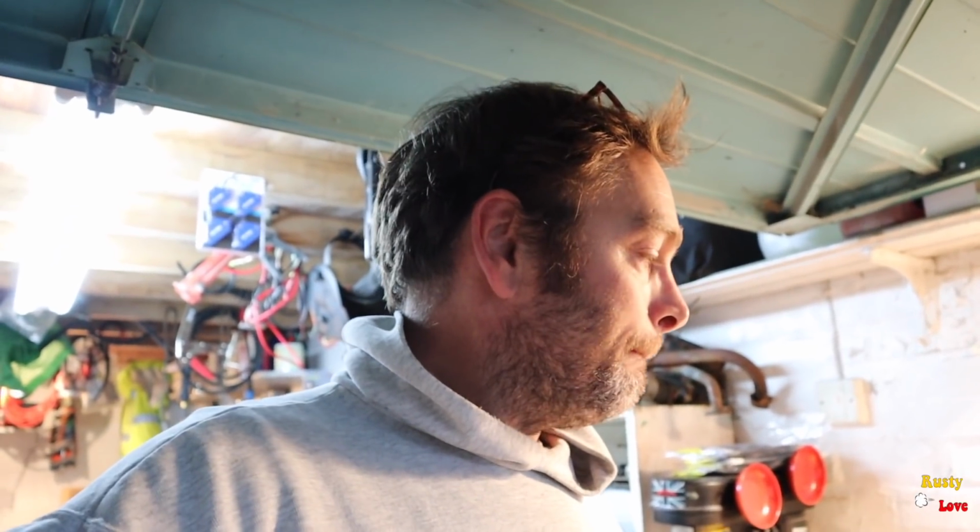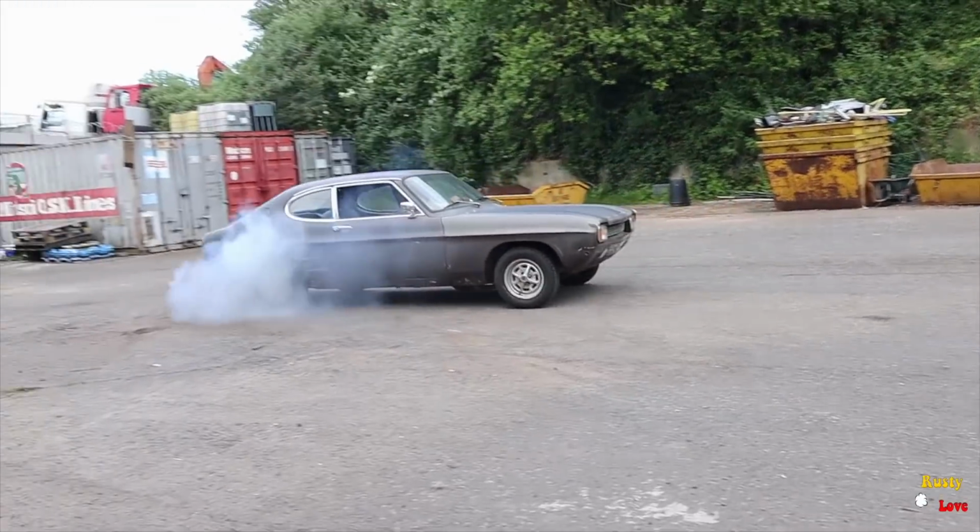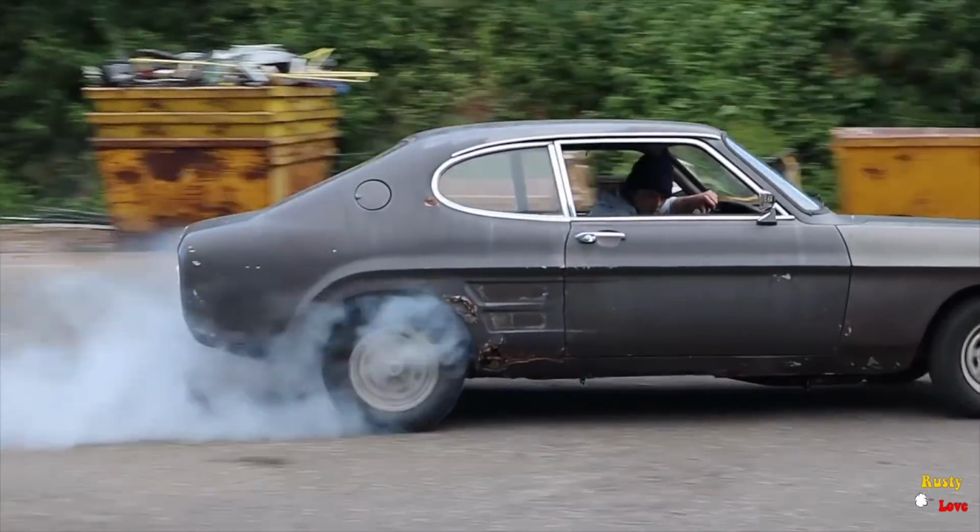Hello there chaps, just before the video starts I want to give you an update. Tomorrow I'm going to Chris at the rolling road again where Kate, Kate the Capri, is, and we're going to fit a brand new, correct this time, Weber 32/36 DGV carburettor on the Pinto engine, which we rolling roaded a couple of weeks ago, and we found out that the massive carb fitted is in fact too big. Well, you knew that.